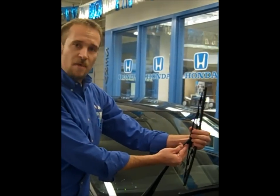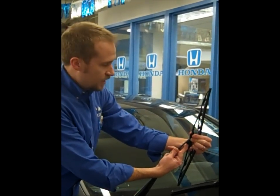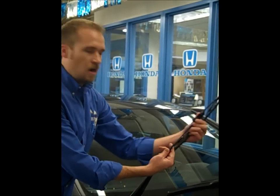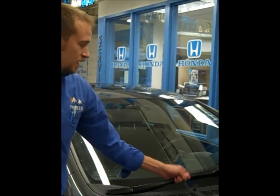Replacement on the inserts is the same on both. First, we're going to want to remove the wiper blade. Do that by depressing the lock tab underneath the arm of the wiper, and slowly work the blade down off the arm. Set the wiper arm back down on the windshield gently — it's spring-loaded, so be careful because they can contact the windshield.